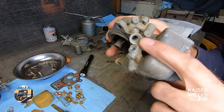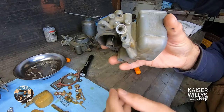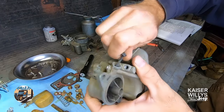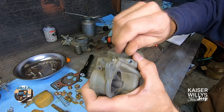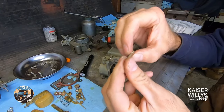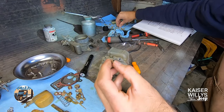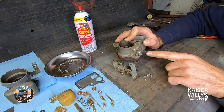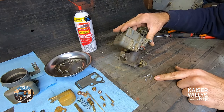Inside this little tube on the side of the middle housing, there's an angled portion that comes up into the main body of the carburetor with a little piece we have to remove. The way I like to do it is take a sheetrock screw, get it in there as tight as you can by hand, then give it a wiggle and you'll feel something pop loose. Notice there's a little washer and this piece - this one's pretty crusty. The master kit comes with a new one and a new washer as well. If you're just doing the tune-up kit, you're going to skip this part.